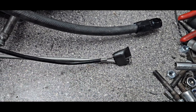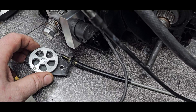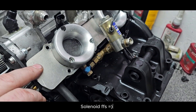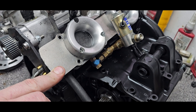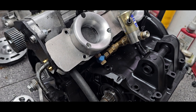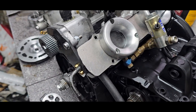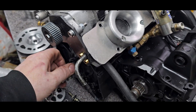When pulling the throttle, this one and the blades are moving at the same time. And this is, of course, a nitrous nozzle — I'm running the nitrous dry, adding fuel with the MAX ECU when active. I haven't set that up perfectly yet, but I have tried it and it made some power. Later the crankshaft went south, though not depending on the nitrous.